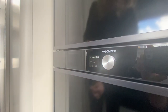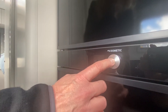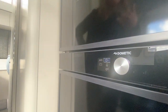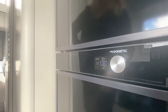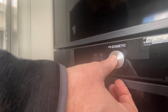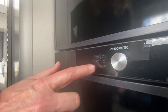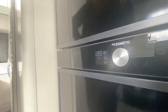To wake it back up just turn the wheel. Press, turn the wheel to enter this level, and confirm. What is shown in blue is active; what is grayed out is inactive. You have the choice of going manually onto mains when plugged into your house or campsite, manually onto gas, or the alternator icon is your starter battery. If you put it manually on the starter battery you will drain your starter battery and then your house battery when not driving — absolutely not recommended. For easy use and peace of mind, put the system on auto mode and it will switch automatically between available energy sources.